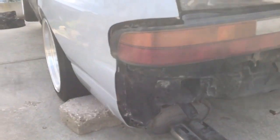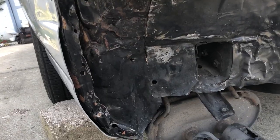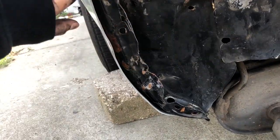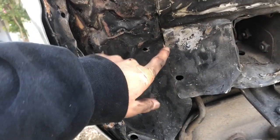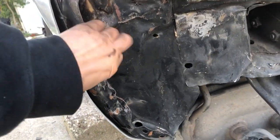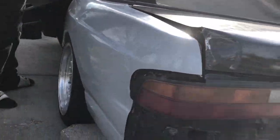Also a little update on the rear: we did try to bang out a lot of this. I tried to record a vlog but my phone broke and all that footage is gone — so I ended up getting a new one. We took out the welds: you find where the welds are — like this one — and use a little metal weld cutter that drills around it. So it takes off the welds and we were trying to bang it back into place. I've got a new trunk coming in soon — baby steps.